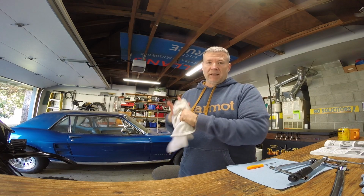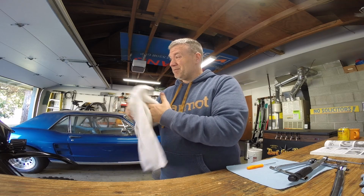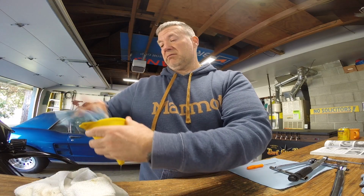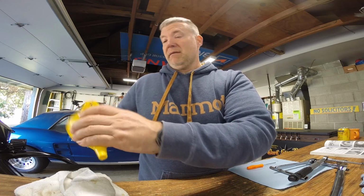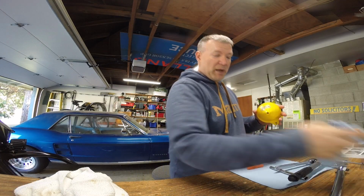All right. Well, pretty simple. When I do the oil change, usually no one's watching, and it's about a 15-20 minute ordeal. Kind of drug this out. So I don't know how long the end video is going to be. Hopefully not more than 20 minutes. But it was very thorough, torque specs, everything was in sequence. You do it once or twice, you'll have it down, and add and subtract things you might want to do on your own. Do I generally use a torque wrench? No, I got a pretty good feel for the torque for 13 and 15 foot-pounds and 8 foot-pounds. So I don't really need the torque wrench, but that is the spec if you ever wanted to know.